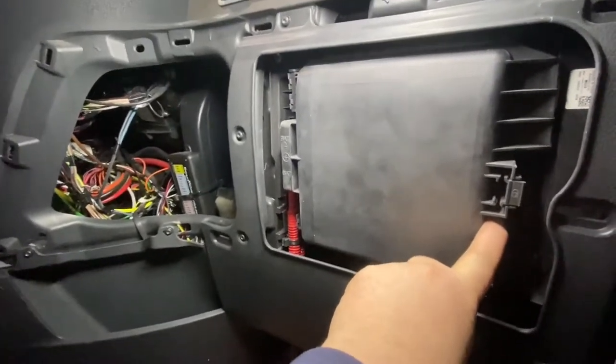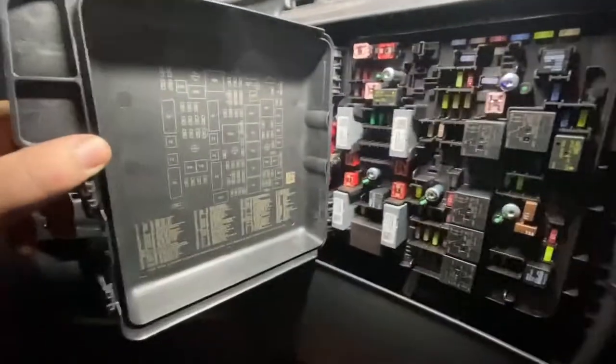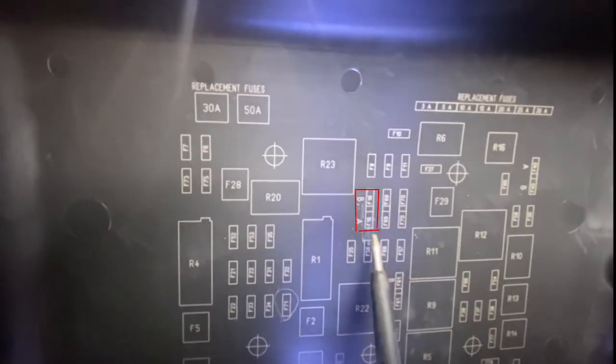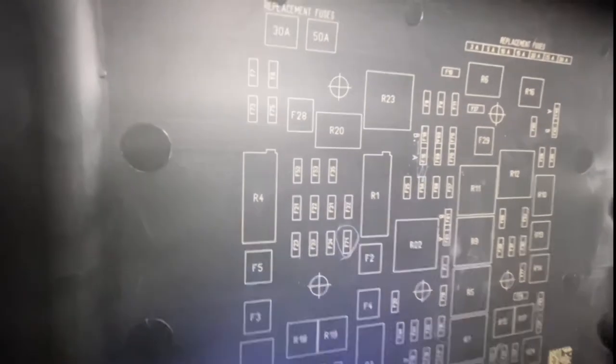Here's the panel, and remember I told you there are two different fuses - two spots. It's F16, right there - a 20 amp fuse labeled 'radio bat power.' And as you can see, F16 has two positions: A and B. I don't know why it's like that - maybe it's a backup fuse, or you can put two there.